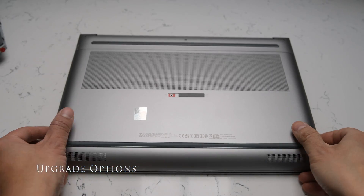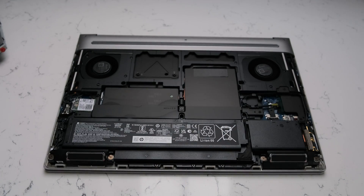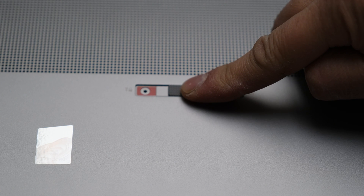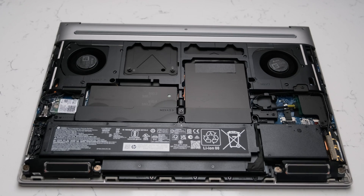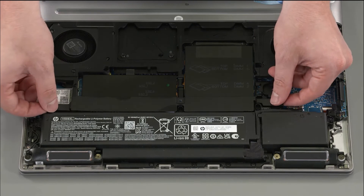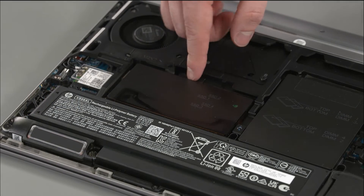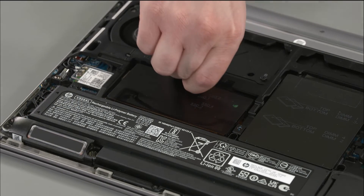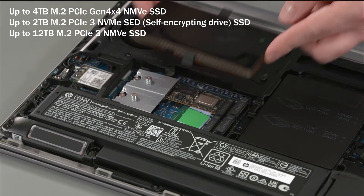The Fury has a beautifully designed quick release latch to slide open the maintenance cover, with a security screw if you don't want users to fumble inside the unit. The internals are the same as the previous G9. To remove or add the SSDs, remove the three P1 Philips head screws that secure the copper bracket to the base enclosure, remove the copper bracket, then remove the M.2 drive shield. This reveals the four M.2 slots. Depending on what type of M.2 storage you use determines the maximum storage available.